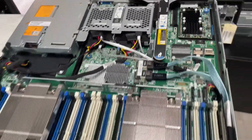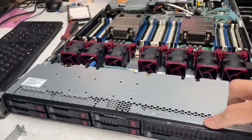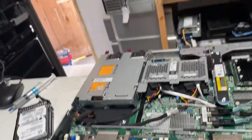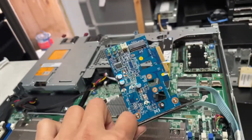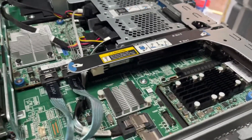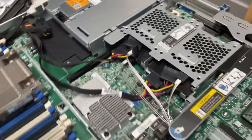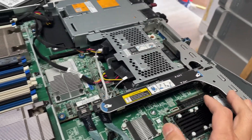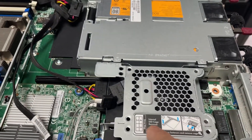So this is how it looks: you've got an 8-bay, some come with a 10-bay, plus four SATA bays from this cage. If you want, you can add NVMe adapters and boot from them, or you can boot from the microSD cards. This cage can also serve as a cache drive for the NVMe adapters. Hope this video helps demonstrate how to install this internal SSD cage.